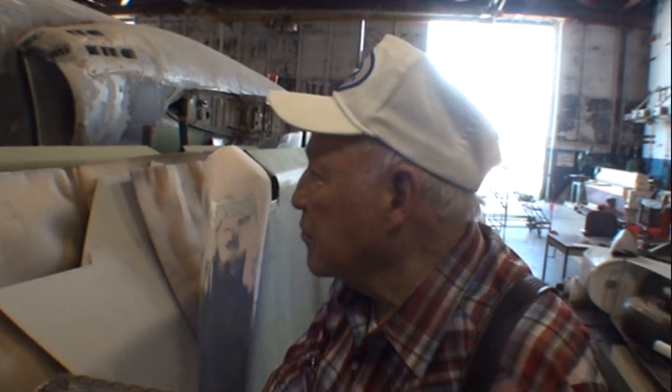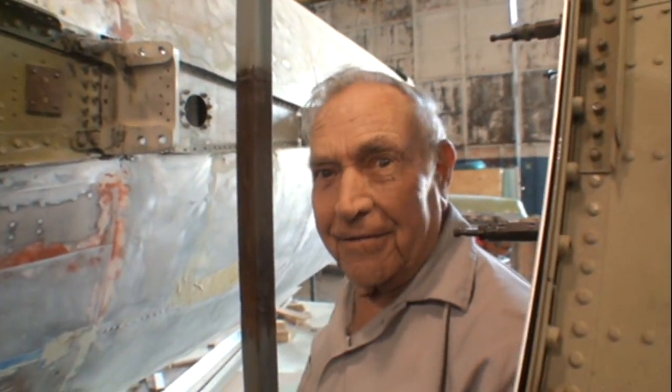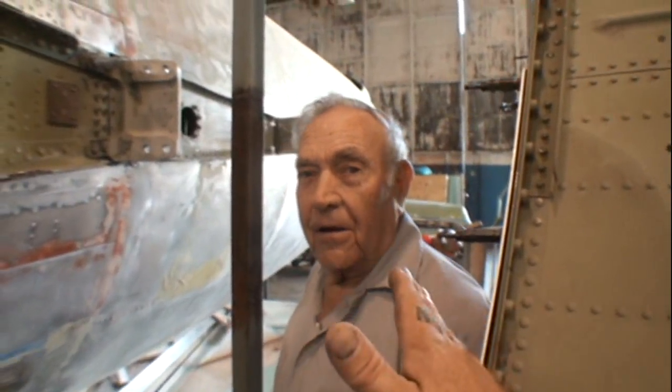Let's go talk to the body man over there while he's not sanding that much. What are you working on, Earl? Well, getting all the blemishes off the body of this fuselage airplane. All the little dings and dents, cracks. It's lunchtime, Earl. Everybody's on lunch break except you. That's right. I don't get a lunch break. Well, you keep up the good work, Earl. You're doing a good job using that DA sander. What are you using there, 80 grit? Use that 80 grit on that. It'll tear it down. It'll leave that rough finish, though. Yeah, but then you go back with 180 to finish it out. I'm going to do it one time. There you go, buddy. Take it easy, Earl. We'll see you later, bud.